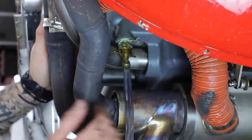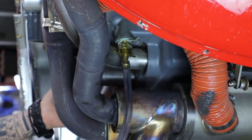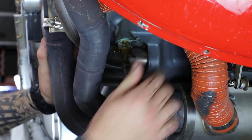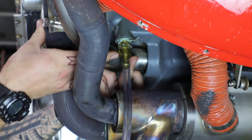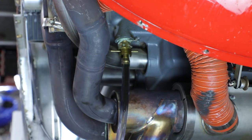So your oil spout on the 200s is going to be forward; 180s are going to be aft, and 180s will typically already have your hose on there ready for you to drain. Any hose that you can get to fit around the nipple on this that'll secure itself will work. The way that this goes is just like any of your fuel drain spouts on the outside of your panels — it's a push up and turn clockwise, and it'll hold it, and then your oil will drain.